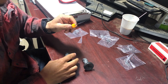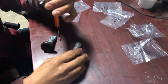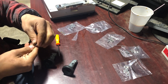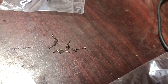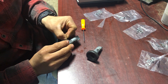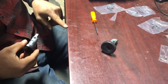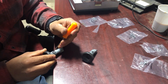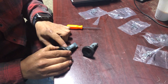So what I'll do is I'm going to do another one to show you guys the way I do it — it might not be the best way, but that's the way that works for me. I'll pull another one out and we have a number four, so we're going to pull one out from number four. Grab our spring — got to keep this in the same order, don't mess them up. Now what I'm going to do is use the table to push down because it's a softer surface, so it will not damage my metal. If I use this one it's going to damage it if I accidentally dink it. We don't want to do that, so then you just test it — see how it moves in and out easy? You know it's working fine.